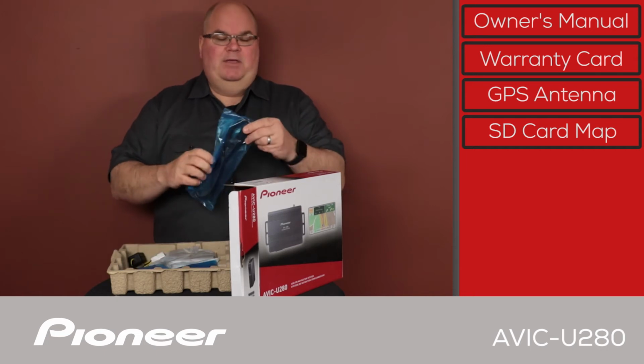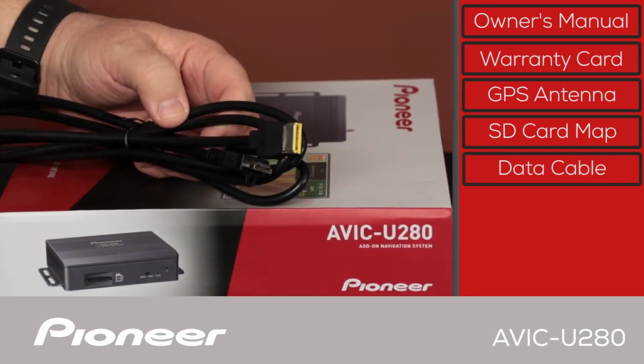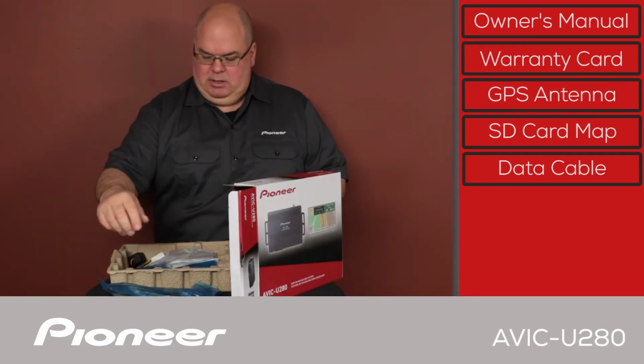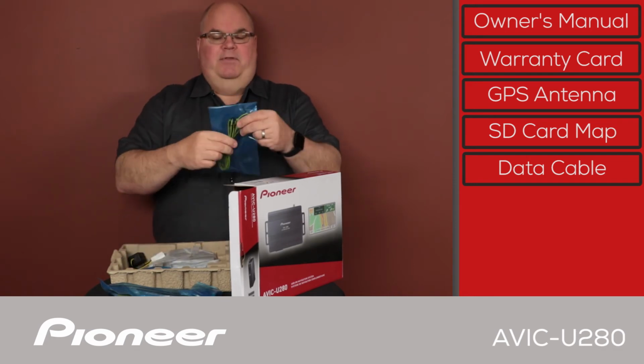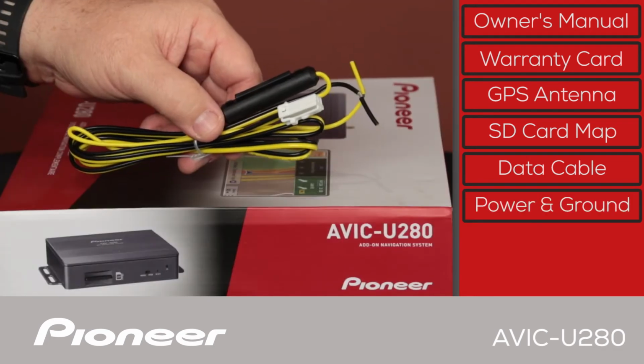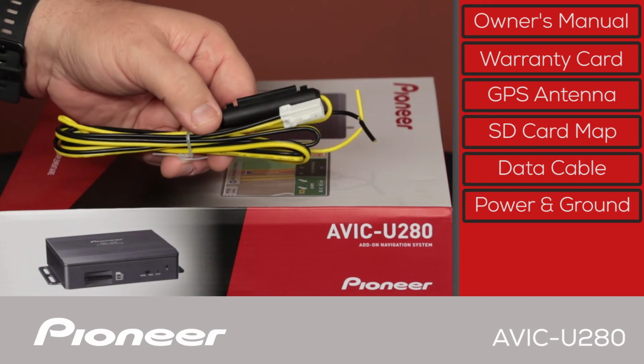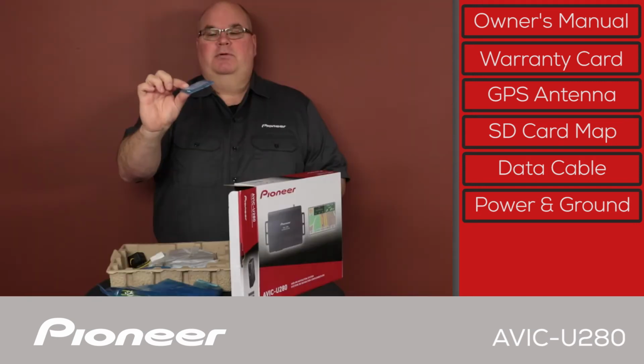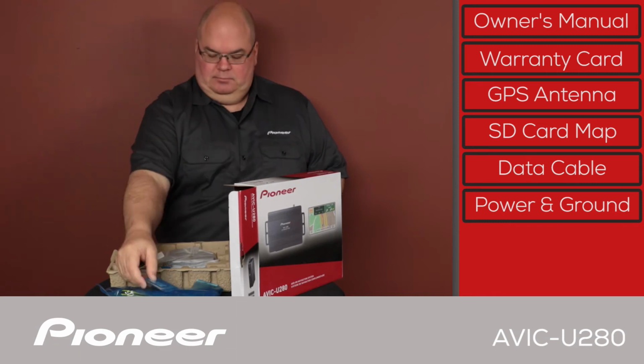Next up we have the data cable. This is the cable that carries the data from the navigation system up to the in-dash receiver and communication back. It plugs into the back of the in-dash receiver, and into the side of the navigation system. Next up we have the power and ground connection for the nav system. And we have some mounting Velcro and some mounting screws there.